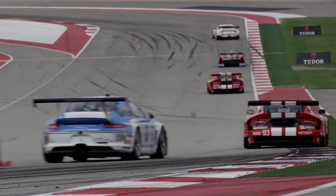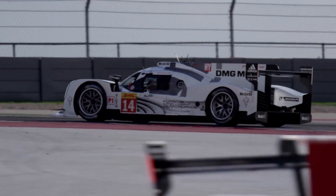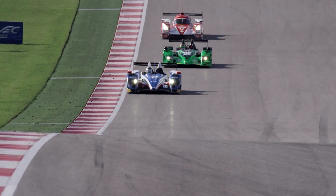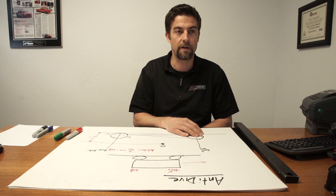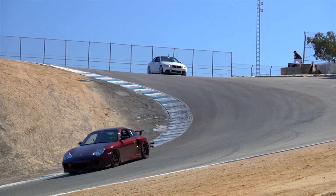In racing, you really want to load the tires as hard and as quickly as possible, because the whole point is to keep the car at its limits the entire time. If there's lag or time waiting for loads to build up, you're not really accomplishing that. Or if you're running a low ride height, you also don't want the front end to drop and scrape any of your front end pieces. That happens a lot on new Mustangs — I've driven some Boss 302s off the factory floor and just out here on the track with stock springs I can actually get the front splitter to scrape the ground.